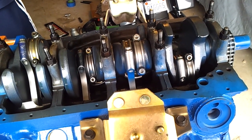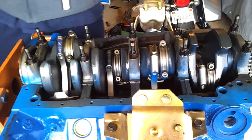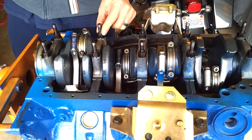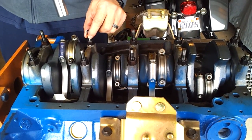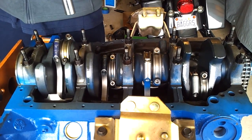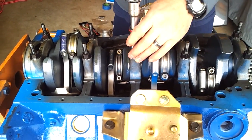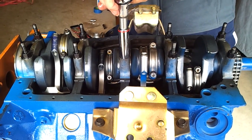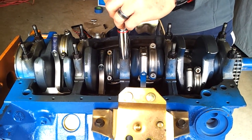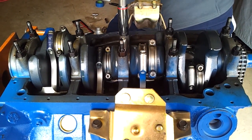So with this setup, if you use the right lubricant when you get your studs in place, you want to torque the studs to 85 pounds. So I'm going to go ahead and just finish up the last 5 pounds so you guys can kind of see where we're at with this, and then I'll get this stud girdle in place, right? So there is the last 5 pounds.